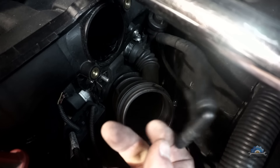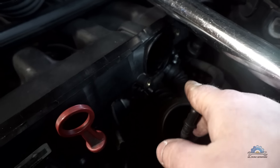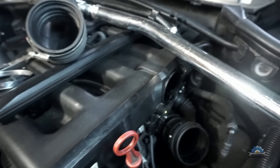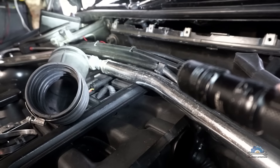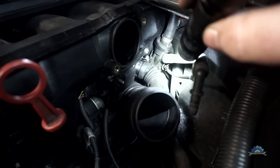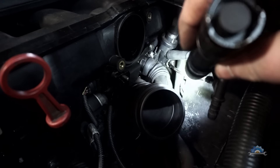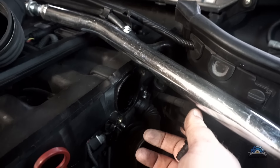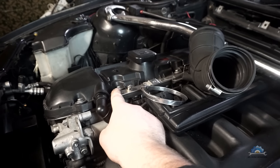There's a small hose going to the MAF connector. This big one has vacuum on idle, and it's controlled by this part called the venturi pump — it sucks air and controls the brake servo, which is on the other side because this is a right-hand drive car. And there's a vacuum here that controls another hose going to the fuel pressure regulator. On the M54 engine the fuel pressure regulator is on the bottom of the car, while on the M52 TU it's mounted here at the top.